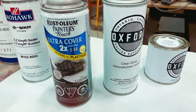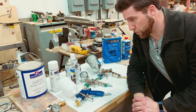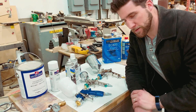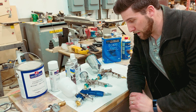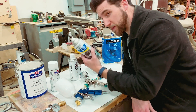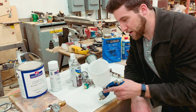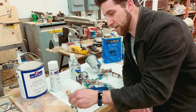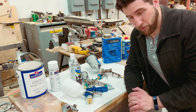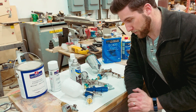Let's start with the first thing that I'm sure is on everyone's mind when selecting between paint guns and paint cans: cost. I'm not going to lie to you — a paint gun is more expensive than spray cans. Also, if you're running a paint gun, you're going to need a regulator generally, and more importantly, a compressor. Something's got to fire some air through this.